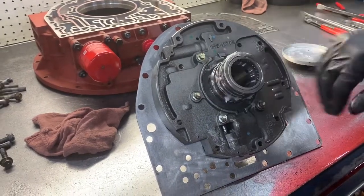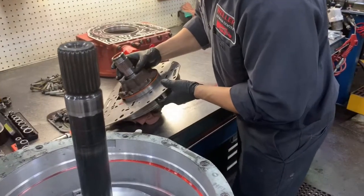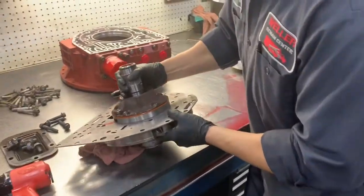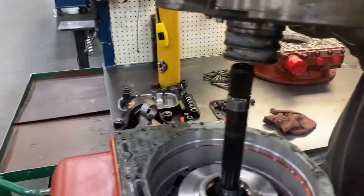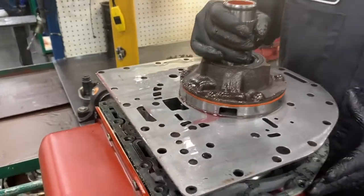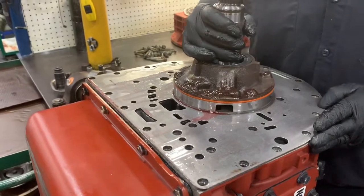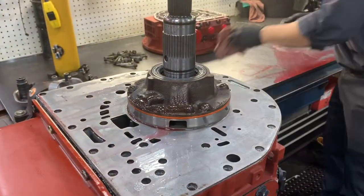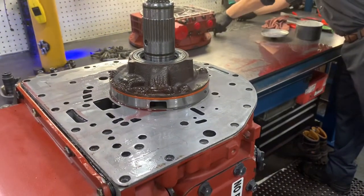Put a little assembly grease so they don't jump out of the way when putting them down there. You'll also have two more plastic Teflon seals on the ground sleeve, and then your orange o-ring on the pump housing itself. Get the bolt holes lined up and just drop it into place. Then you're going to have your other gasket for the converter housing to the support plate.